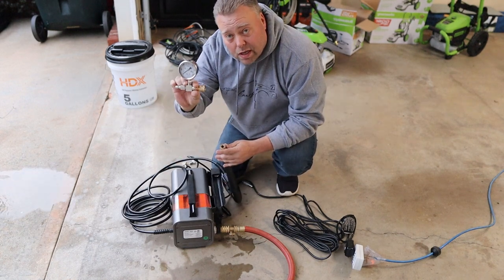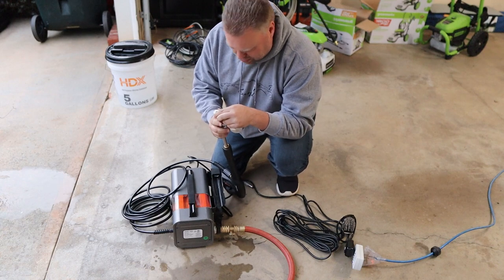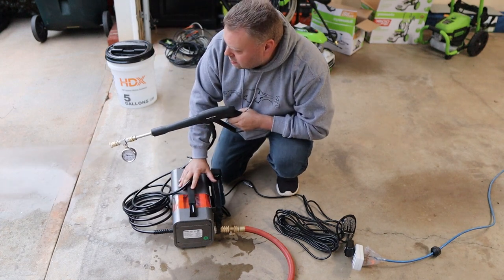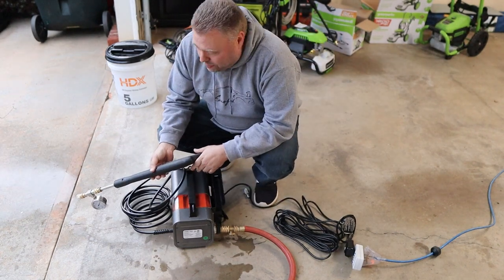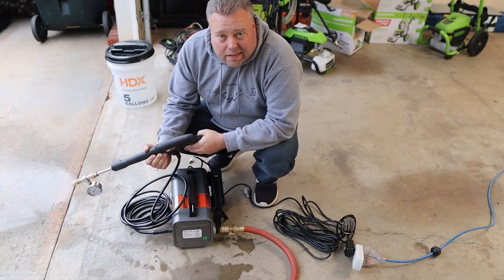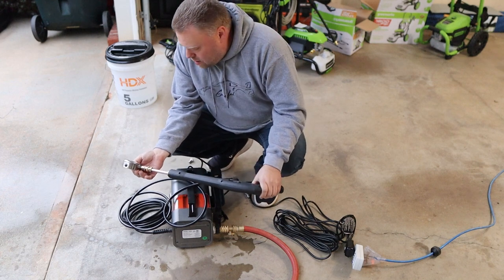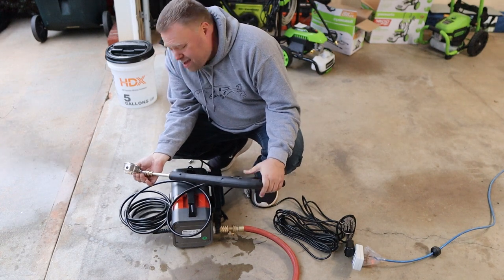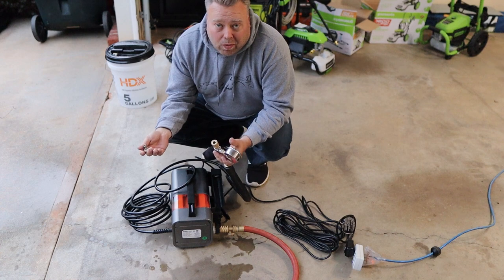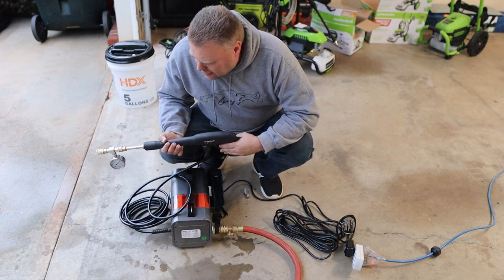I have my quarter-inch pressure gauge here so we can check it out. We have a 3.0 and a 1.0 nozzle to judge everything. We've got water flow — let's turn the switch on. That's not much pressure — already one thing I'm kind of disappointed in. I hate that sound, but if it works well I can deal with it. We're reading 950 PSI, so basically out of the box you're already at the minimum of what you need for car washing. 950 PSI is pretty much exactly what you'd want, and we're pushing 10.6 amps at that 950.